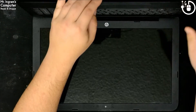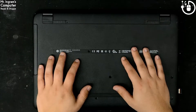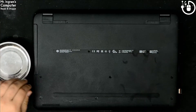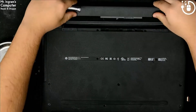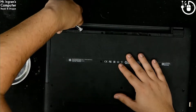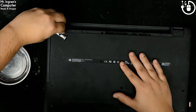Hold the power button to force it off. The model number is TPN-C126, that's what we're working on today. Step one: get a bowl, get a screwdriver, and take the battery out first — always take your battery out. We're gonna remove these pads right here; they should reveal some screws for us.